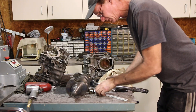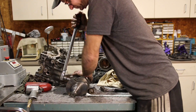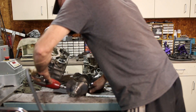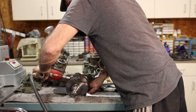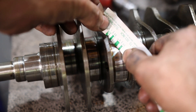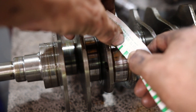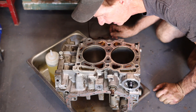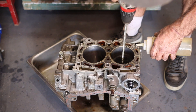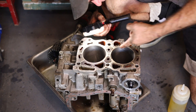Before cleaning everything up, I'm going to check the bearing clearance with the plastigauge. Put the plastic gauge in, torque it down to 32 foot-pounds, take it apart. Be careful not to make it turn. The clearance should be 0.0008 to 0.002. It looks like it's 0.002 — perfect on the clearance. I took it outside and pressure washed it. Now let's hone the cylinders — that ought to do it.